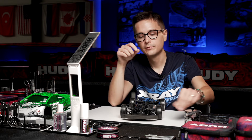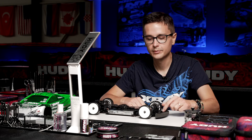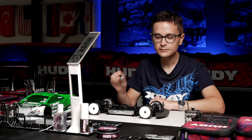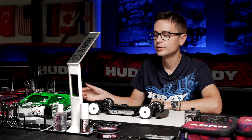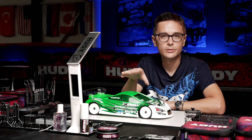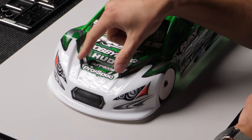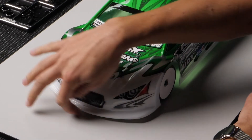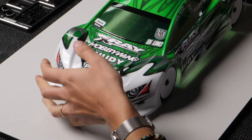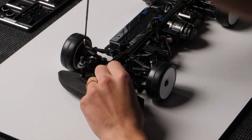So what are the benefits of using the body upstops? The point of the body upstop is that when you go into a corner, the suspension is compressing and the body shell will get close to or touch the ground. But if you use the body upstops — I'm going to loosen these to exaggerate the effect — if you put these very high, they are going to push the body shell up.